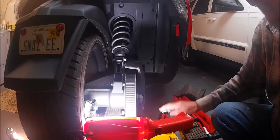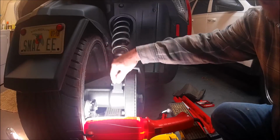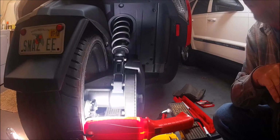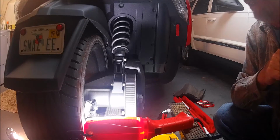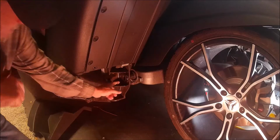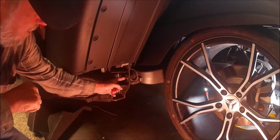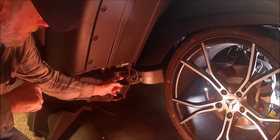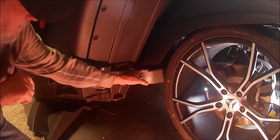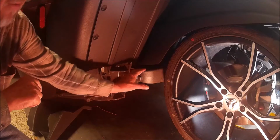Okay, so you're going to need some form of jack. This is my motorcycle jack that I've used to do tire maintenance and what have you. It works very well for this type of work. So I had it and I'm using it. And this is where I selected to jack it up. This is the 22 millimeter Allen. This is the pivot shaft, and this is what's going to make the adjustment of your belt alignment. It actually moves this whole swing arm left and right.